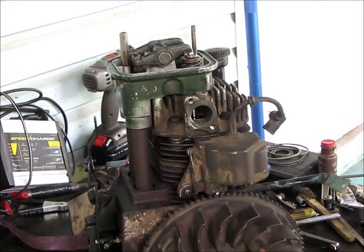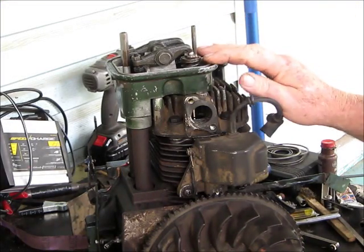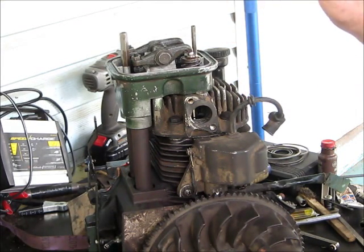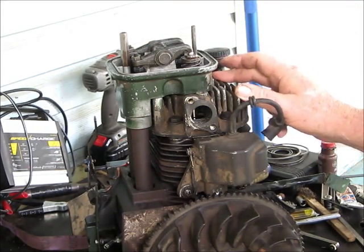For those that don't know about it, these two companies' old engines - 10 horsepower probably, up to 16 horsepower - they've got overhead valves. In order to get the head off this thing, you've got to take this assembly off, and of course doing that you've got to take your valves and everything loose.